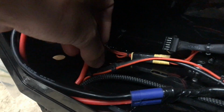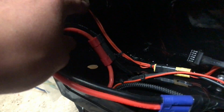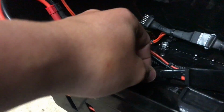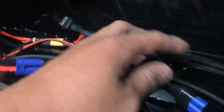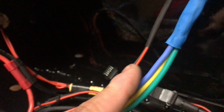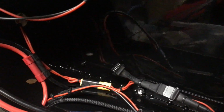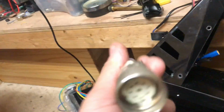I've got my main power wires from the controller, 10 gauge, coming up here. Goes into this splitter, this connector bit. Comes into there, through the shunt. Then I've got just an open wire on the shunt at the moment. And up here I've got my, these are charge wires. These were originally phase wires from my old e-bike. That's why they're those colours instead of red and black. But I was too cheap to buy more. So there's that. And these two small red and black ones, these are data from that big circular connector. There's another 4-pin XLR circular connector, that's the big one. That's for my home charger.